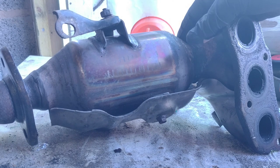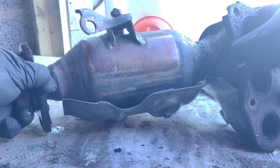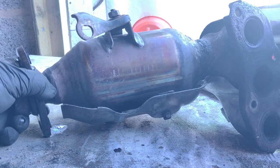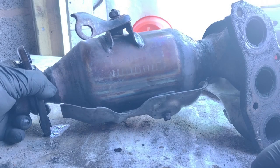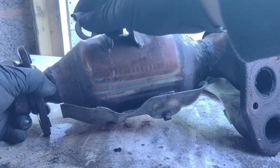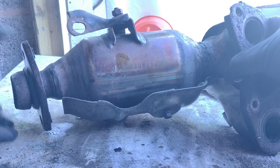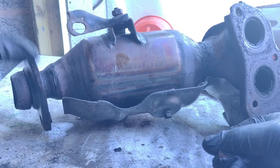Because you see, the downpipe goes there, and that's wiggling itself there. The manifold itself is going blah, blah, blah, like it's a V8 or something, and that's obviously putting pressure on the joint here, because from here to here it's allowed to flex. So this bracket is there so that the whole thing vibrates, and at the joint, where I suppose you could argue there is a bit of movement allowed, it does the movement there instead of higher up here.